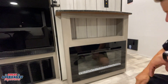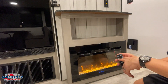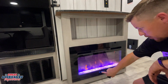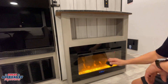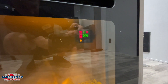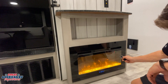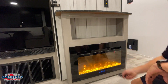Here we have our fireplace. There's a sensor up in the top right where we have to aim that remote to turn it on. We have Celsius and Fahrenheit temperature we can change to. This little flame icon changes the dimness of our flame. If we want to change the lighting of our flame, we hit the light bulb button on the screen. If we want to operate our heater on a timer — it's an electric heater — this button looks like a clock. When we push it, we can see times pop up: one hour, two hours, three hours, all the way up to eight, then zero hours to turn the timer off. To change our temperature, we use one of the two buttons at the bottom — we can raise it until it kicks on, lower it to kick off, or keep going until it says ON so the heater stays running all the time. One more click and it says OF, meaning that system turns off.